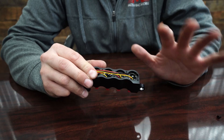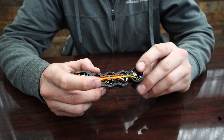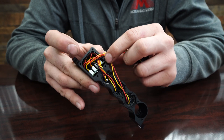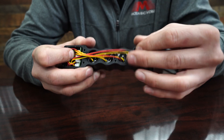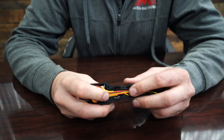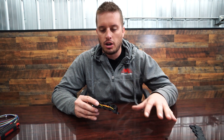The modularity of this is awesome. As your car and project grows and you suddenly need a 200 psi or a 5 bar or 7 bar, it's as simple as taking that back cover off, sliding the pod out — and if you look in here there are just little two-pin connectors attached to the board. Pop those off, pop a new one on, put it back together, and you don't have to rewire anything. Because if you're familiar with project growth, going from a standard MAP sensor to a 3 bar or 5 bar often changes the connector every time. On this, your sensor signal stays the same, your ground, your power — all you do in your ECU is recalibrate to the new data calibration and you're good to go. You don't have to rebuy things, remount things, or buy adapters — just swap the pod and move along with your day.